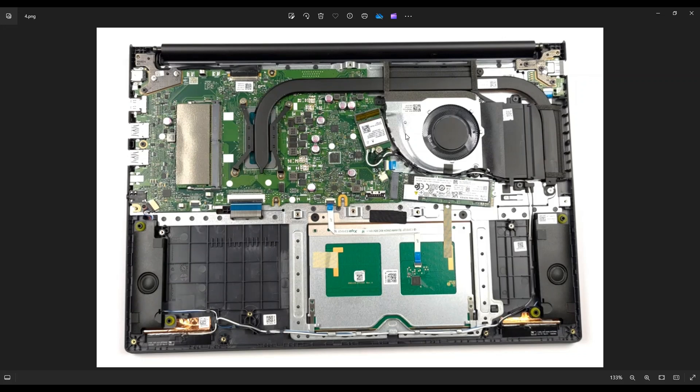Next thing I'll shout out is your Wi-Fi card here in the middle near your fan. Similar to the solid state drive, there is a single screw. You would take that screw out and the Wi-Fi card would be released, but you also have this black and white antenna wire that runs down through the fan to the antennas on either side. So you have to unsnap those — they pop straight up and out of the computer, they're just snaps. To get them back on, you need to hold them at an exact 90 degree angle and apply some pressure to snap them back on. If they're not at a perfect 90 degree angle and you push too hard, you can damage them. So it may take a little time if you're not used to it.